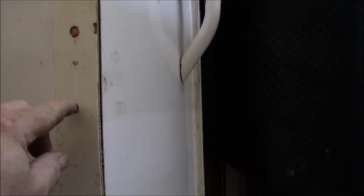So you know, we got the big stock, that big 1.5 by 1.5 piece of steel. Remember, that's in there. So now we got to get these bolted on there. Let me show you what we did, because this thing is pretty cool. All right. A lot of times you get out and you're going to have to tap something into it, right? You got to get something to thread into that steel. I don't want to put lag bolts back in there. They're not going to hold. You wouldn't get them in. That steel is way too thick. We literally have to tap that steel.